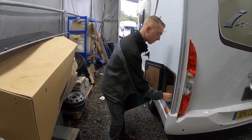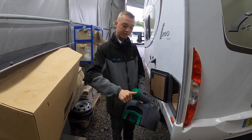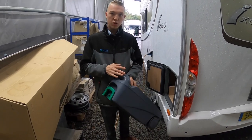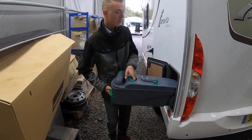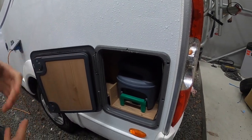If you are using the chemical, fill this up with your chemical then tip it in here — the green or your blue chemical. Or if you're using the tablet foam which are in the sachets, put a pint of fresh water back in the cassette, push it back into the vehicle, and then drop one down the toilet and that will break up into the liquid.